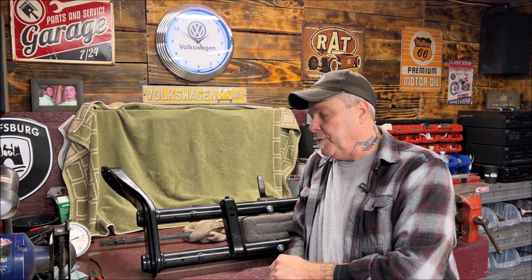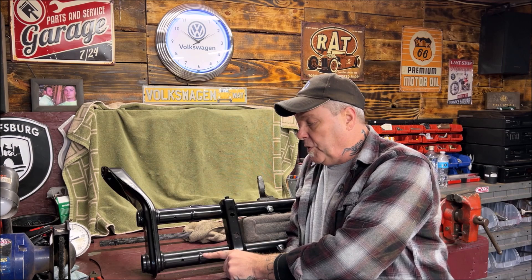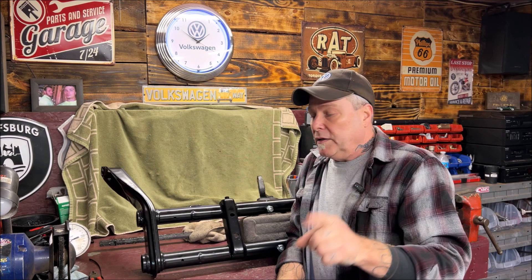In a nutshell, that is how you lower the Volkswagen Beetle. There's nothing hard about it, but especially in the front end, a lot of calculations come into play. So just take your time and think straight before you start ordering parts like I did. This is brand new — I'm going to go ahead and throw it on the marketplace, give somebody a little discount, and then buy an adjustable beam and put that in. One thing you're going to want to do whether you get a new one or not: remove the grease fittings out of your old German beam and reuse them in the new one.